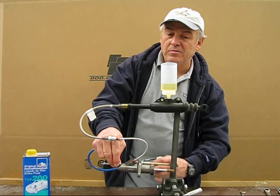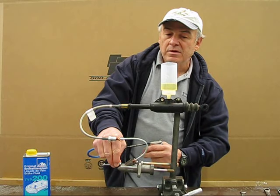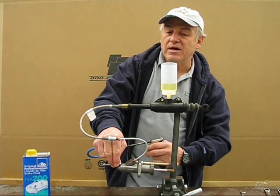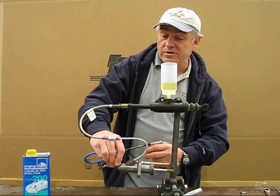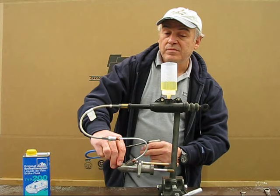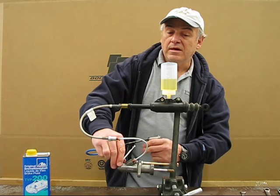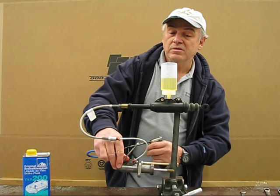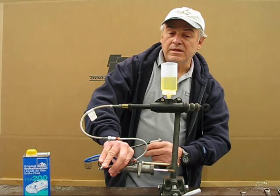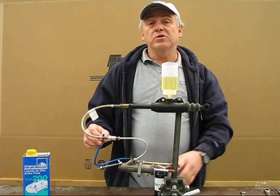You're going to see a little bit of air coming up there, and the master cylinder is essentially chasing air out of the bottom — and there you see it coming up. All those air bubbles you see are bubbles that you would normally be trying to force through the bottom of the vehicle, which you will never fully accomplish. Once I've got all the air bubbles out, it'll almost be nothing coming out, and then I'll slowly start closing the bleeder screw. At some point it completely stops, and at that point you've got no more air in the system. You can disconnect your line and you're almost ready to go.